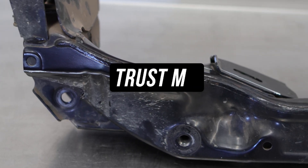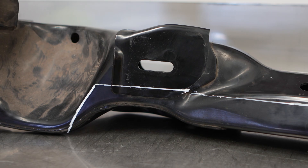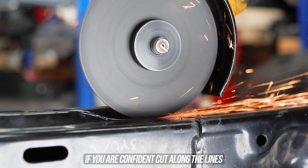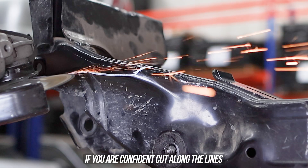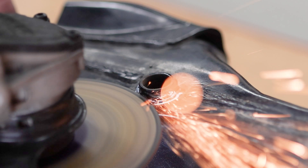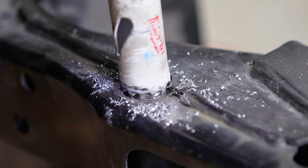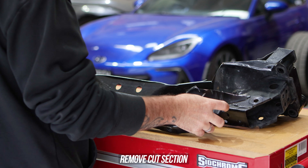Remember, it's so goddamn important to measure twice and cut once. Trust me — if you're hesitating and you're not sure, go stick everything back on and make sure all the templates line up properly. If you're confident that you can proceed, cut along the lines all the way around the subframe as you can see from these super sweet cut shots here. Towards the end, cut alongside the bottom of the tube at the front that we marked, which will free that sucker up. And now you're in the thick of the surgery with the subframe split in two.